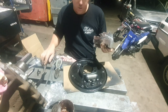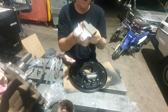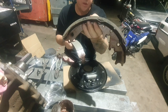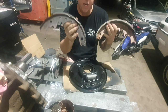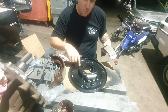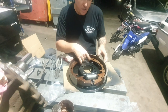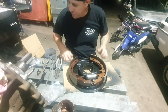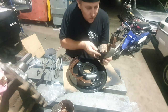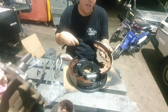Next, shoes. Shoes are front and rear specific — they're not side specific, but they are front and rear. If you have a look, you'll notice this one has considerably more shoe on it than this one, and it's a bit thicker — the smaller one is our front shoe and that is our trailing or rear shoe. The handbrake comes in from my right, which means they go this way — one there and one there, just where that handbrake piece comes in. The first order of business is attaching this lever arm to the underside of here. Things will only go where they need to go, so he goes up into that hole.